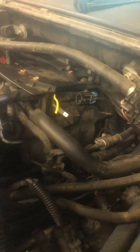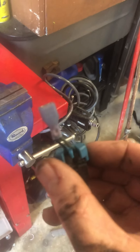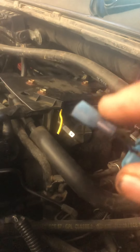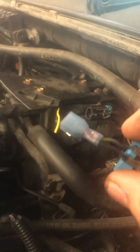That cable there — that blue one — there are two knock sensors in a Vortec, but you can wire them together in parallel. I've crimped a plug on one side of the socket, and I just need to crimp the male end of this blue plug onto the wire which runs across to my single knock sensor.